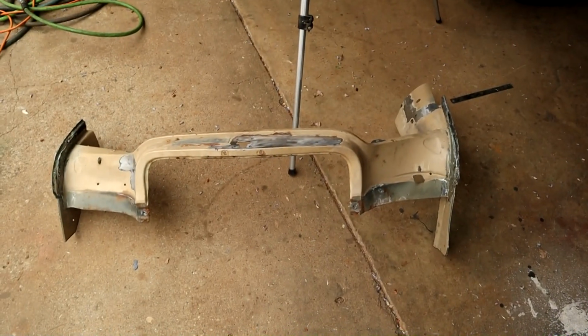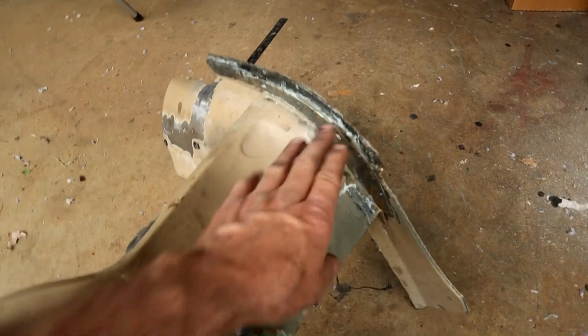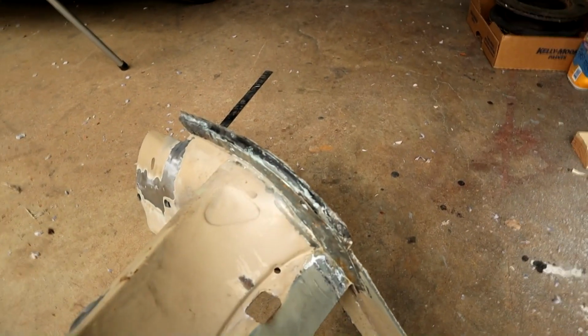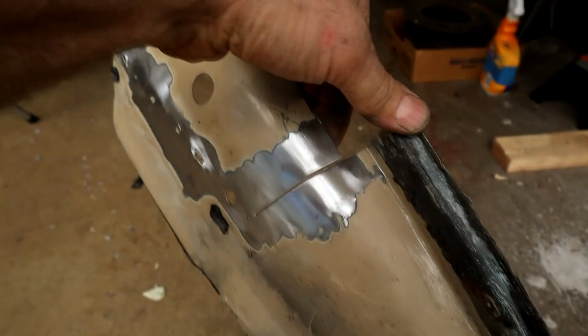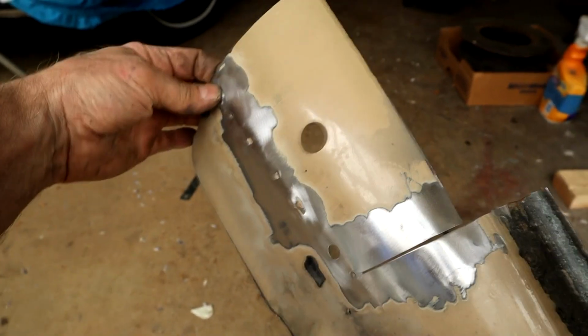So this is the new radiator surround, new to this guy obviously, and I chopped out the sections that I needed, and this is the area that we were having trouble with. Obviously the join from here to here was all completely rotted out, so I'm going to clean all this under seal, make sure this is all clean and sealed up nice, and then we'll have all our nice fresh bolted edge. Where I was cutting it off, I ran too far with the grinder, and see where there's a break there, I can weld that, no problem, get that welded and you won't see that. Weld that in. There's a few little spot weld damages here that I will correct before it gets welded in.